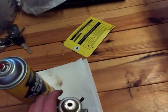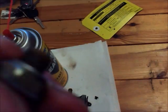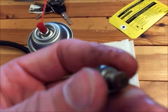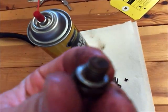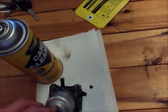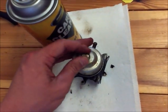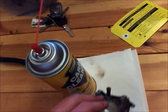They can be a pain to restart if you leave gas in them. Making sure this is clean, it has to be almost perfectly clear. They're really tiny jets, and on those Briggs engines you want to make sure they're cleared. I just did a pressure washer for my friend that sat and didn't run, and we sprayed it out with carb cleaner, and carb cleaner still wouldn't start.